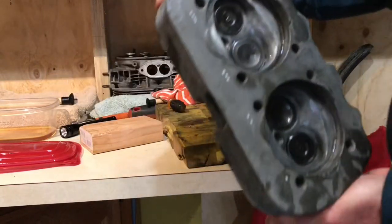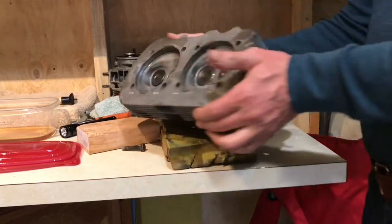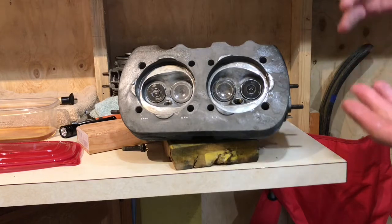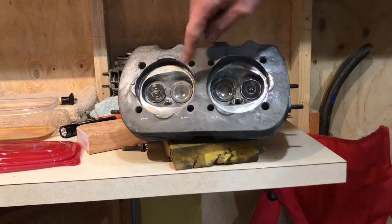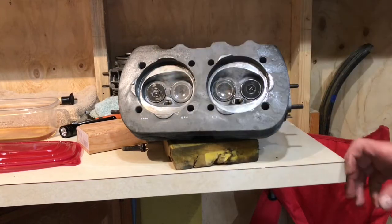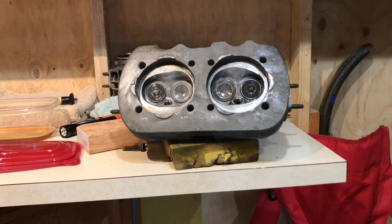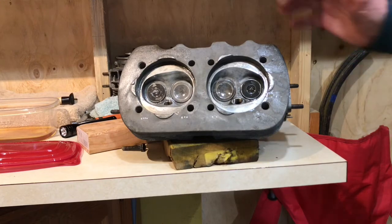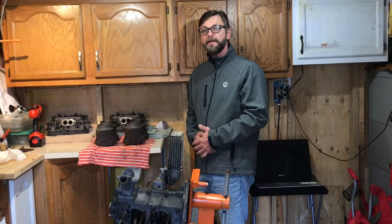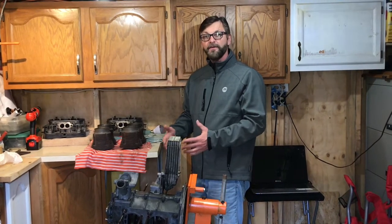That's what they look like now — I'm pretty happy with that. Let's do a quick recap: we had our head valves, they were used, I dipped them in degreaser, cleaned them, took all of the carbon deposits out, and did some valve lapping because I had the valves out and wanted to ensure good compression when installed. If you like the contents of this video, give me a thumbs up, follow me on YouTube, and that's it for today. Until then — Junior out.